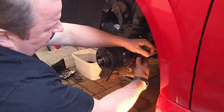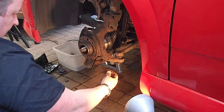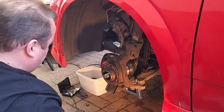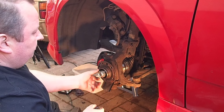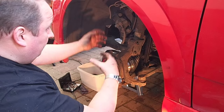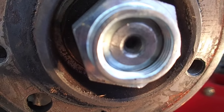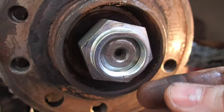The next one is the steering track rod end. This might start to spin — it's 18mm. Just give it a tap down to seat it properly. Just put that on loosely for the moment until we're ready to tighten up. Now we'll get the caliper bolts in and put the caliper in place. We'll put some thread lock on those bolts as well. Look at that nut — see how it's flattened off. That will cause resistance when we tighten it up, so it'll be a tight fit, and provided we torque it up to the correct setting, there's no fear of that coming loose.